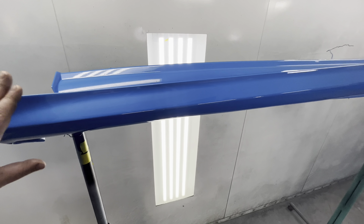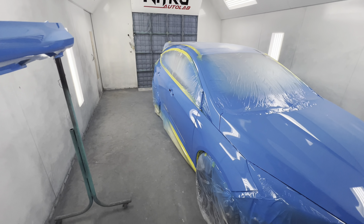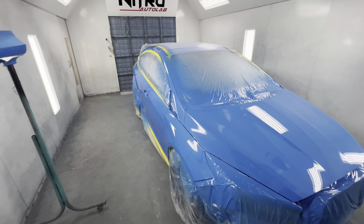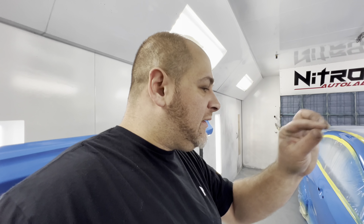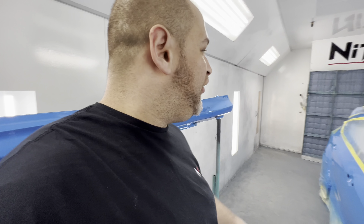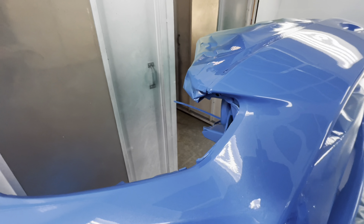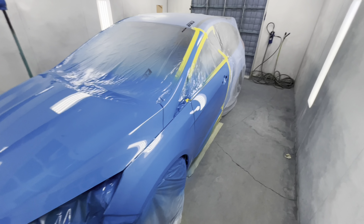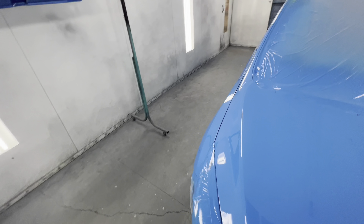So today we are going to go ahead and get this thing unmasked. We're going to get the door handles installed, door panels back on, mirrors on, headlamp and front bumper reinstalled, rocker panel back on, and we'll probably do a little bit of color sanding — knock it down with 2500 grit, a little 3000, and nib out a couple spots. Nibs are just dust particles that land in the paint. Even in a spray booth, anything can come off your clothing, your mask, or the air hose — it doesn't take much to get one little speck in the clear coat. But it sands right down, you machine buff it, and it goes totally flat. I couldn't be any happier with how this thing came out. Very fun color to spray, not an easy color. Blending is a must on this color — it is not a 100% perfect match. Our customer is going to be super pleased.